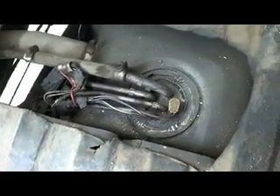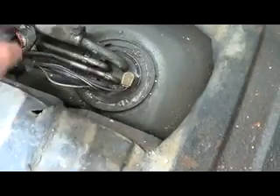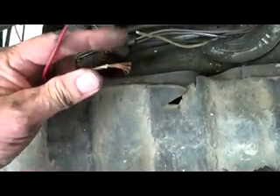We're inside the back of the truck. I cut a hole in this box 15 years ago. Here's my fuel pump — I pulled this out of a junk car at the junkyard. I know that this wire right here goes to my fuel pump — that's the electric wire. So I'm just going to copy it: I'll take this wire and snip it right here and run it up into my new electric fuel pump at the front of the truck.